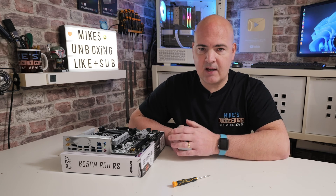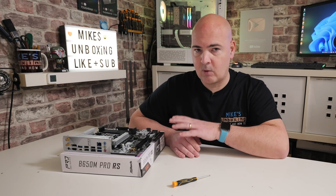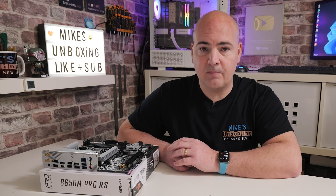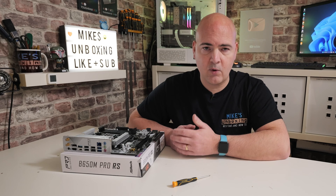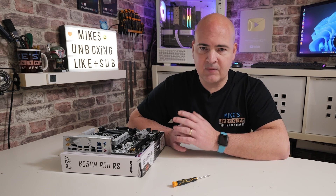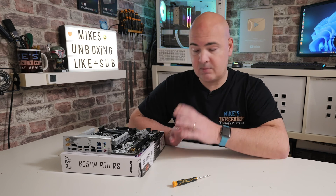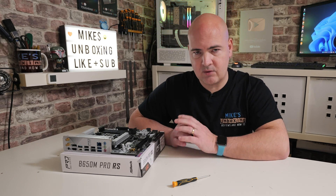So if you are changing your system — changing any parts, maybe you've swapped out a processor, maybe you've swapped out your RAM — clearing your CMOS is a really helpful thing to do, especially if you're building a new PC or changing out parts and your system simply will not work. It could be because of invalid BIOS settings, or you may have overindulged slightly in some settings and the system just will not boot. So what you want to do is reset the CMOS.